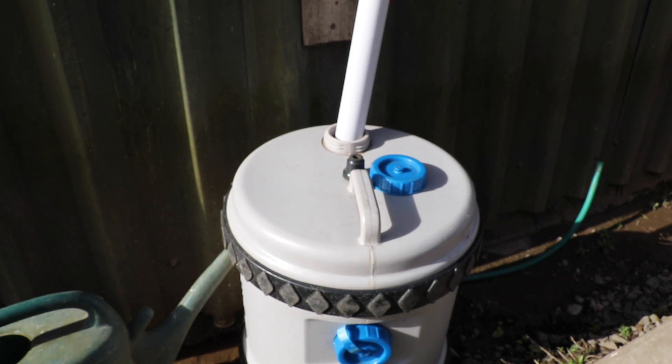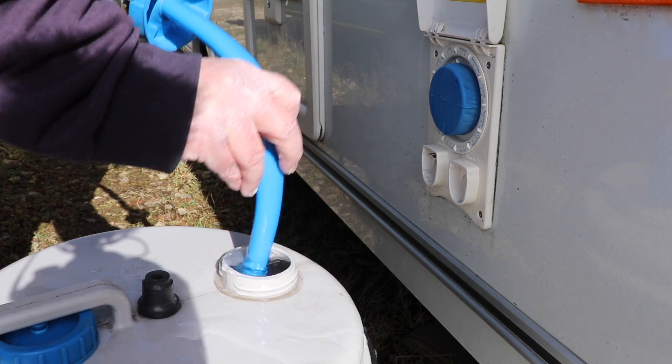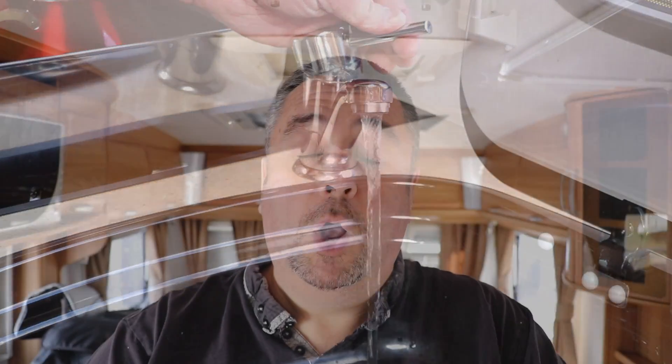Once the system has rested, it's time to start flushing through. Use up the entire Aquaroll through the taps — kitchen tap, bathroom tap, and shower — pulling all the water through to remove any biofilm. Once the Aquaroll is empty, refill it and repeat this process two or three times depending on how dirty the water was and how long you left it standing. After pushing through about two Aquarolls' worth (roughly 80 litres), pour yourself a small glass and smell it. If it smells chemical, put more water through. If it smells fine, have a small taste — if there's no acrid taste, the system is fully sterilized. If not, run more water through.